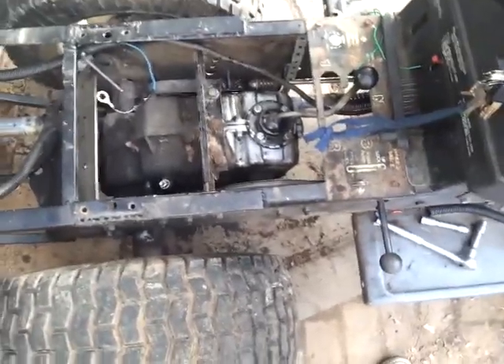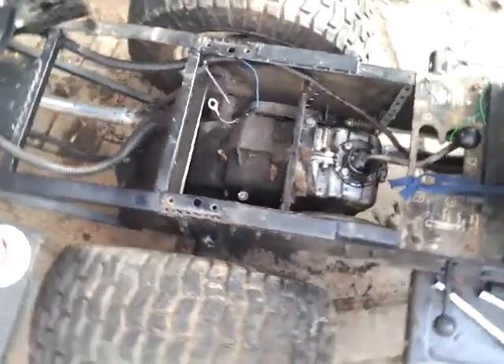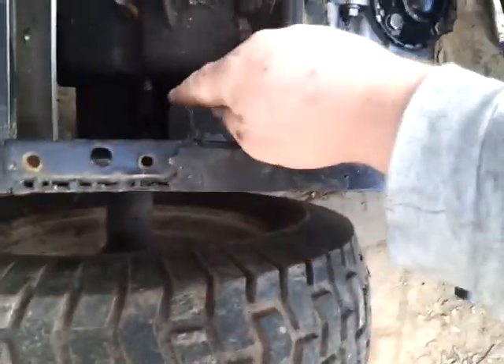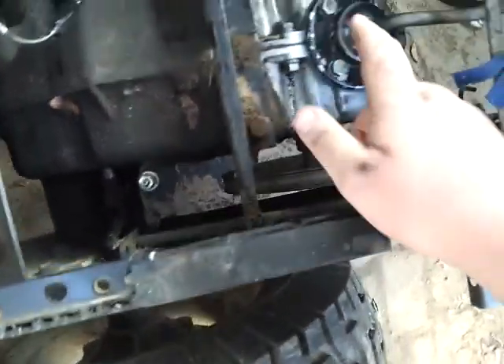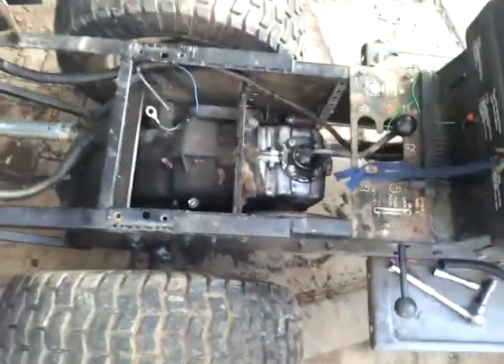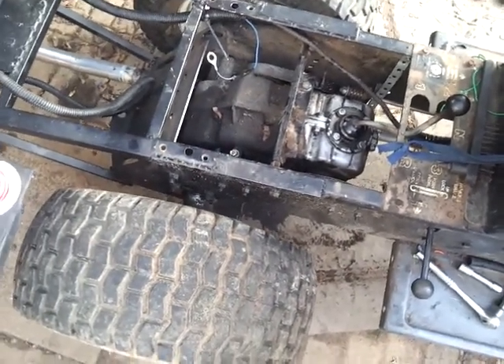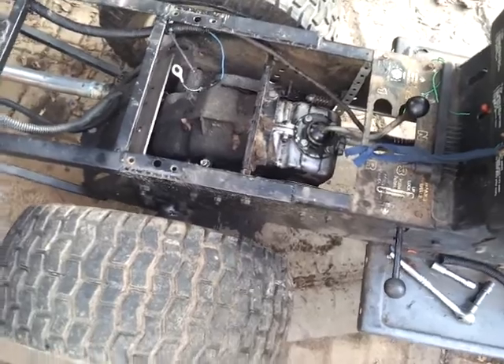This thing is just about ready to go. I also changed the oil in the transaxle - it was pretty black, probably original. The drain plug down there by my exhaust pipe was next to impossible to take off. To fill it, you have to use a tiny opening, so I removed my shifter and filled it through there. There's no real information on how much to put in, so I filled it up to the input shaft. If anyone knows exactly how much it should be, please leave it in the comments.